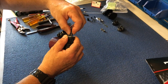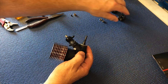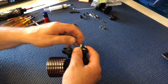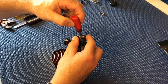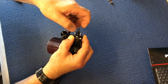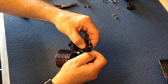Then the collet — slide that over. Most importantly, pull the crankshaft so that there's no end float. When you put the flywheel on you're not going to get any backlash with the pins hitting the back plate — you don't want that causing any problems. So a little dab of thread lock just on the thread, just a touch. Make sure you get your clutch nut the right way up, just mount that down.